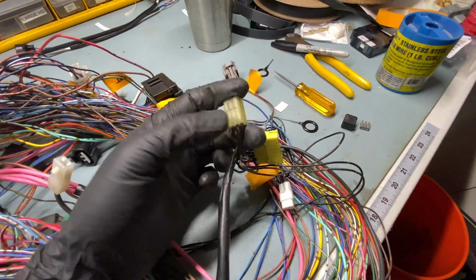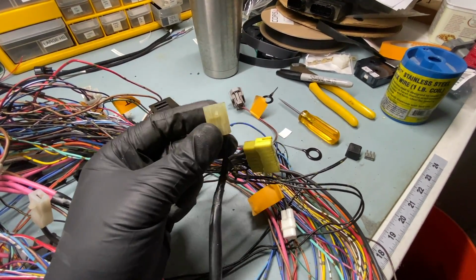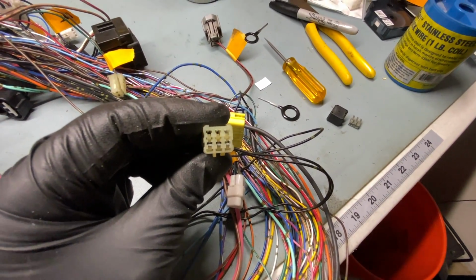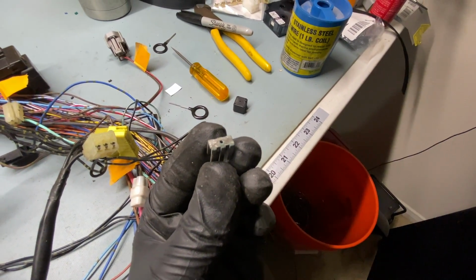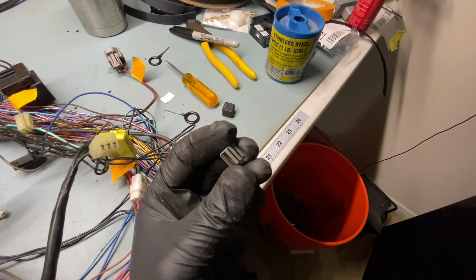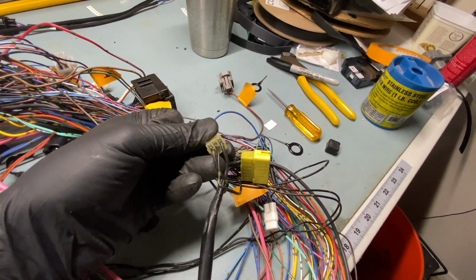We've pulled this guy apart. Now, this is a little junction block. Yamaha uses these to connect, in this case, a bunch of grounds together. Unfortunately, this is a point that Yamaha didn't do a great job on, because if you look down in this connector, and hopefully I can get my camera to focus on this, there's some corrosion on those pins, which can be seen a little easier on this guy, because this is what actually came out of there. This is what makes the connection. See that green on there, that corrosion on those pins? I pull every one of these apart and inspect them because there's something that Yamaha does not do a great job of. This is not unlike all the rest of the connectors, this isn't a sealed connector.